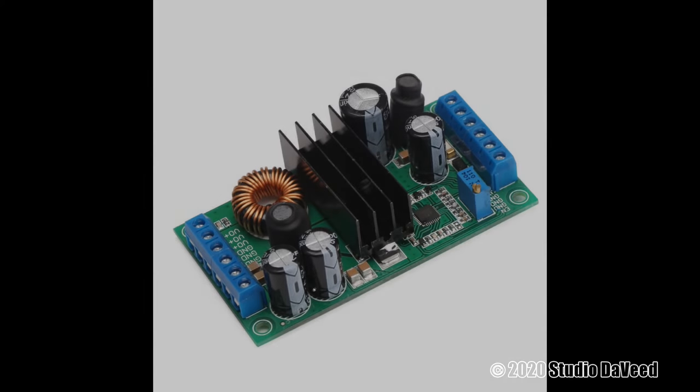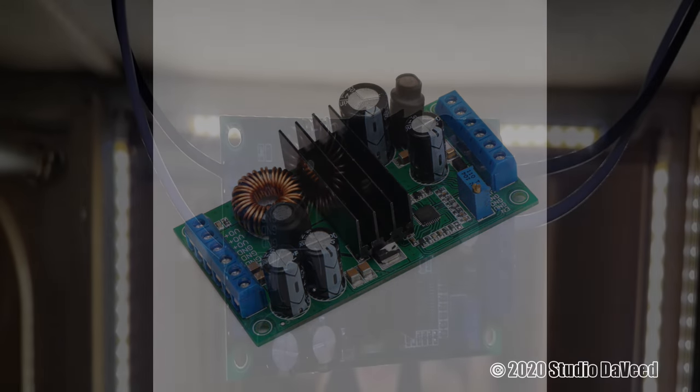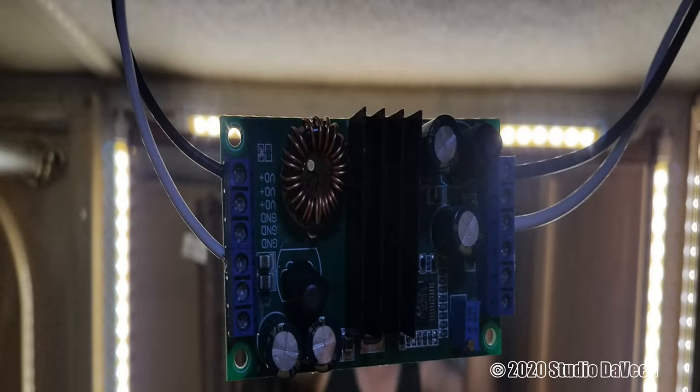So what's a guy to do? Well, there's a thing called a buck converter that you can install on the fan — it's pretty straightforward, and I'm going to show you that now. That will dial down the voltage going to the fan from your RV power source down to 12 volts. This converter hooks in between the RV power wires and the fan power wires, and then you can dial the voltage down to 12 volts.